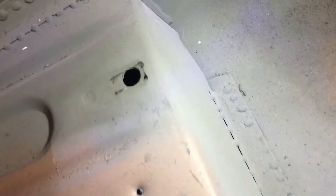Since the old sheet metal was so thin, I made brackets just by bending sheet metal. Once I got those in, I did little stitches all the way down — stitch welded all the way around the entire floorboard piece where metal could be contacted. For the seat platforms, I did the same thing all up the sides and all down the front. Got all that in, plus a little patch panel up there — this actually looked really nice.